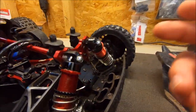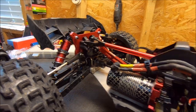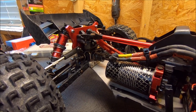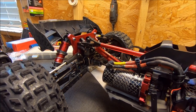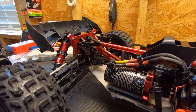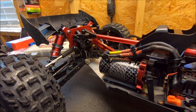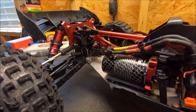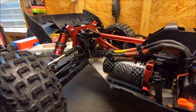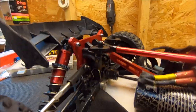The system actually rips in this truck. It's definitely my go-to system for most of my 6S trucks. The diffs — I did swap out to open diffs in the front and in the rear. I switched out the LSD for straight open. I took out all the slipper plates. What I did is I added in one extra large shim. So in your diff behind the planetaries, you have one large and one small shim behind the planetary. I basically just added one more large. I still got 50,000 in the front, 200 in the center, and then 20,000 in the rear.